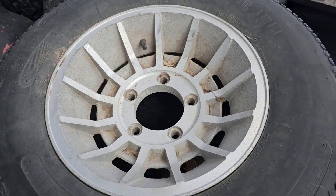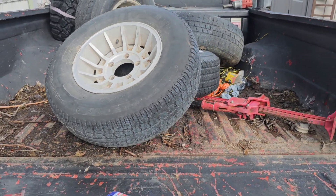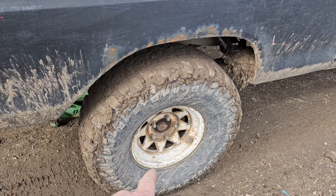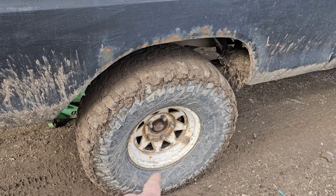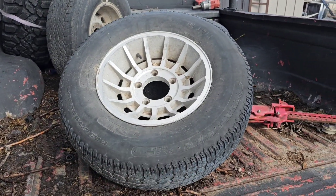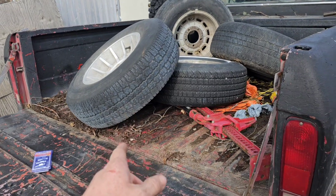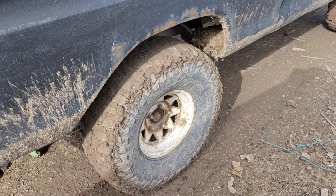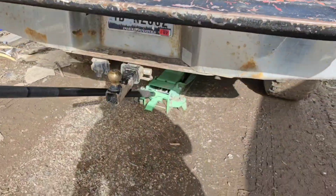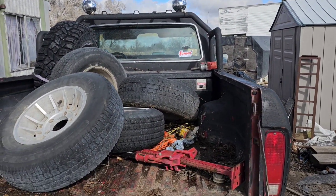Let's get these pulled out. You've got to do it in the right order so you get the right wheel on. First we're gonna take off these wheels and take the tires off so we don't have to change them twice. Always start with the wheels you're getting rid of, then pop the tires off and put them right onto the new ones. These big tires can really be a wrestling match. I already got my jack positioned and my Milwaukee 18-volt impact ready.